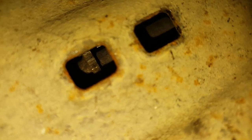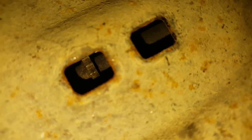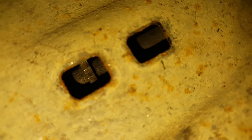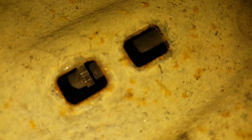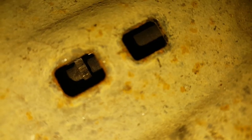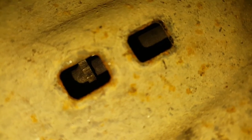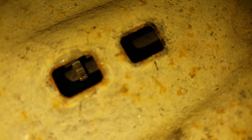And it's important that you adjust it so that the shoes start to bind on the drum and then back it off a couple of clicks. You do need to have a clearance between the shoe and the drum, otherwise things will start to bind up as things warm up and your brakes will bind on. Right, all that's left to do now is to bleed up. Ford Courier.